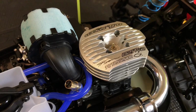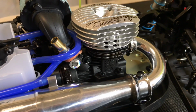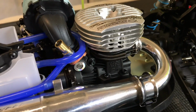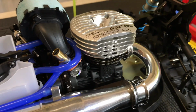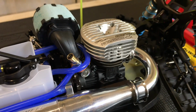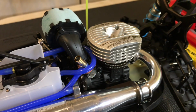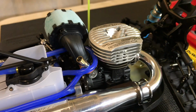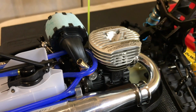It's pretty much the B2101, reworked a little bit, is what I was told by some of my longtime OS buddies around here that know OS really well. They told me it's the B2101 that he used to win the Worlds. Supposedly it's the same porting. They reworked a little bit of the crank timing, but it's essentially a 2101 with some added touch to it.